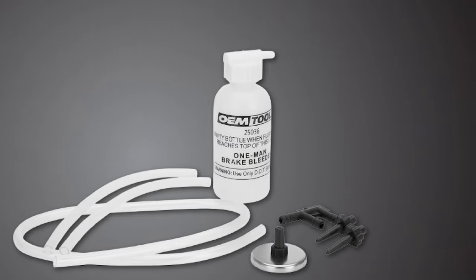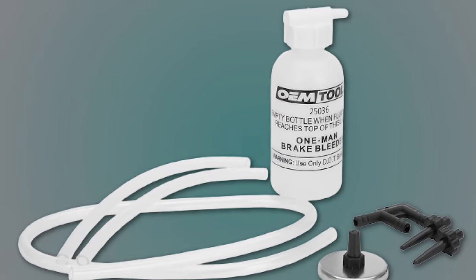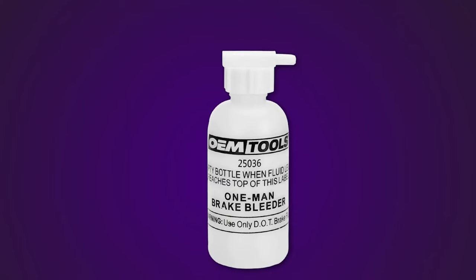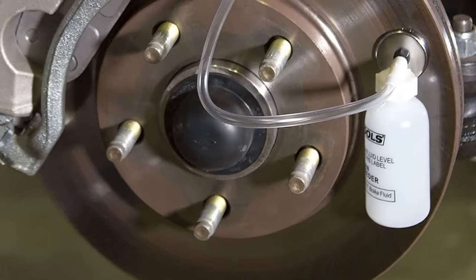Yes, it's a bit easier if you have a helper to push the pedal, but this cheap and easy bleeder doesn't require that. Though it won't add more fluid to the master cylinder, and it will only hold a few ounces of old fluid, it also won't set you back big bucks, and if you lose or break it, you're not likely to care. Just pick up another one next time you need one.